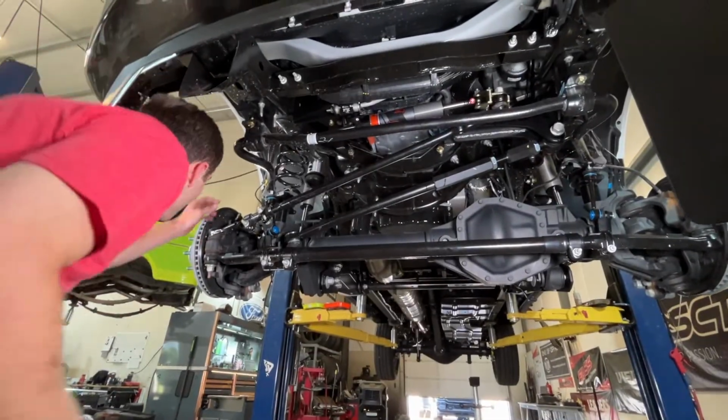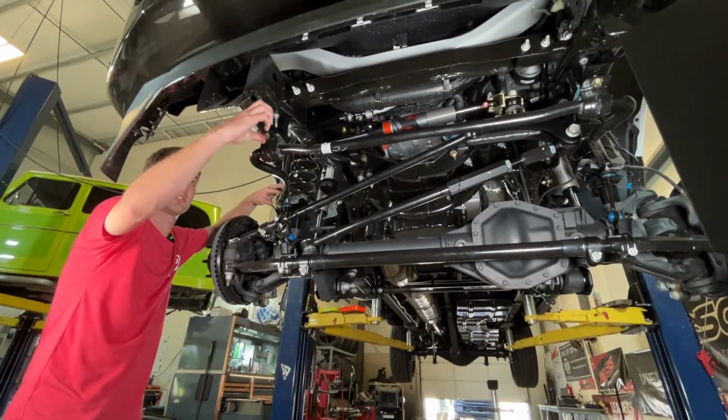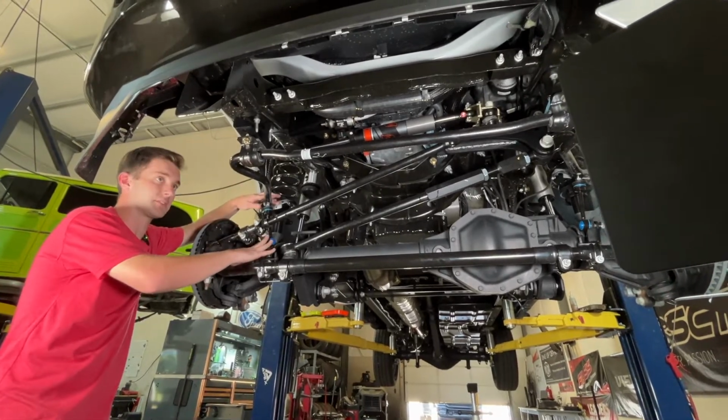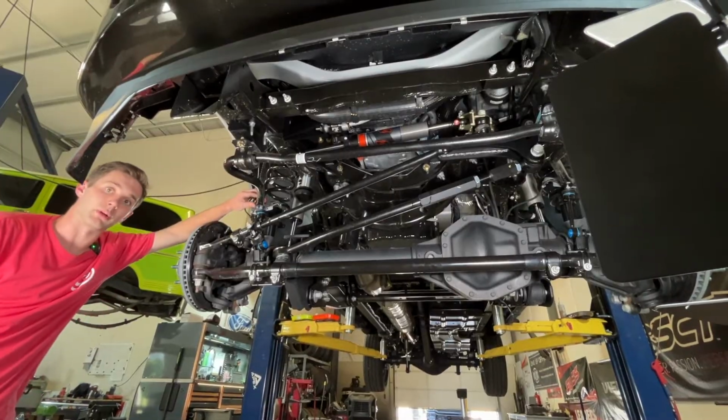We're going to now torque our sway bar end links down to 50 foot-pounds, and then these 2 bolts on the sway bar drops are going to go to 33. So we'll get both sides' end links at 50, both sides' worth of here at 33, and then we'll be done with the sway bar relocate.